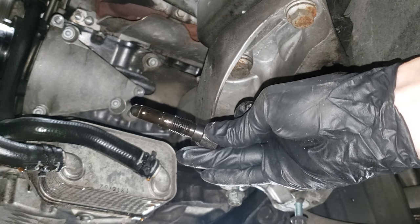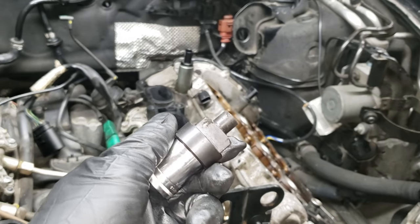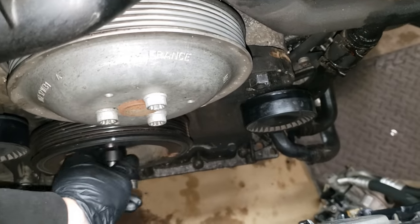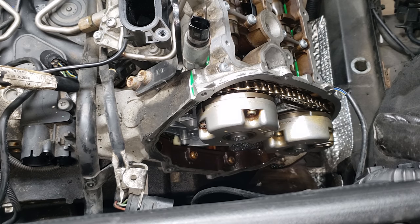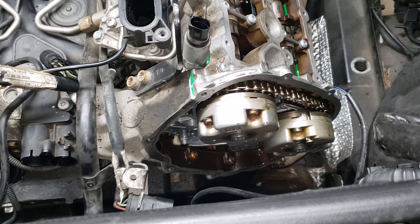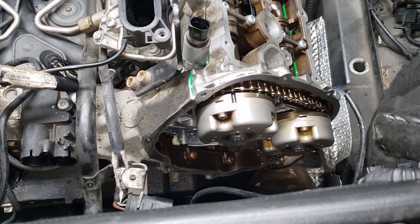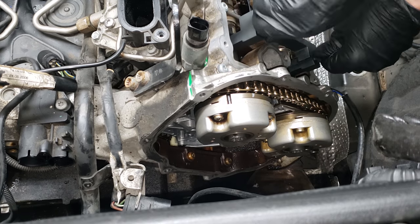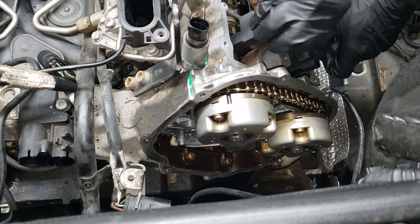Here we are with the car in front lock position. I have the AC condenser removed, the power steering pump removed, all the coolant lines disconnected, belt's taken off — everything's pretty much ready. My next step is to remove that locking pin and remove this pin now because I have to be able to rotate the engine to get to the torque converter bolts. The torque converter bolts are located through this slot — there's three bolts holding the torque converter right here. After that I'll remove the bell housing bolts and then the engine is ready to be pulled out. Luckily I got arms like a vegetarian so I'll get up in there. Now with the locking tool I'm going to slowly turn the engine clockwise to make sure that the timing is still right.